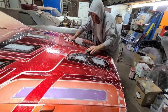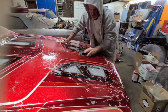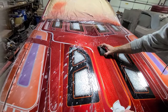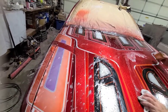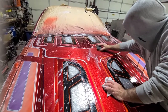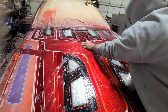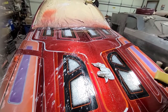You guys get the idea. You can see what it sounds like when it starts — it doesn't take long to knock that off. Now I'm just lightly dragging this off. We're not going at an angle or anything, just to show you. You see how quick it goes away. We'll hit up here again — it starts getting smoother sounding. It goes from that rough sound to smoothing out. You can hear, you can feel where you're at. You just have to be patient with it and you'll knock it out. But there it is — that's how I do my wet sanding.